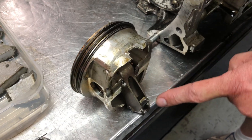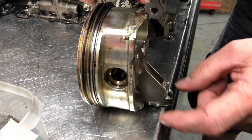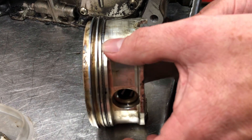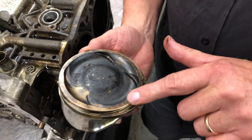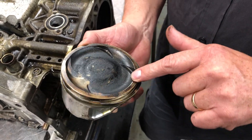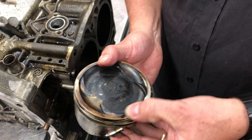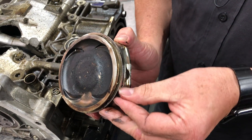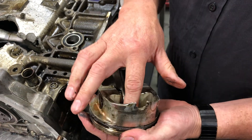What you can see here is the top half of the piston and the top half of the con rod — you can see it's still pivoting. Given the catastrophic engine failure, the gudgeon pin is fairly normal, a bit gritty, but that's pretty typical. At the top of the piston it's a bit dirty but there's no signs of pitting, no signs of uncontrolled ignition or detonation. This carbon is fairly normal, and if you clean it back the piston is actually in pretty good nick. Around the side of the skirt there's no sign of ring land failures.